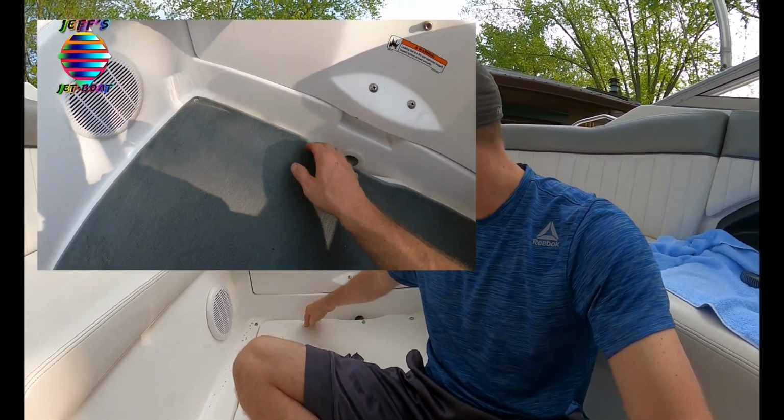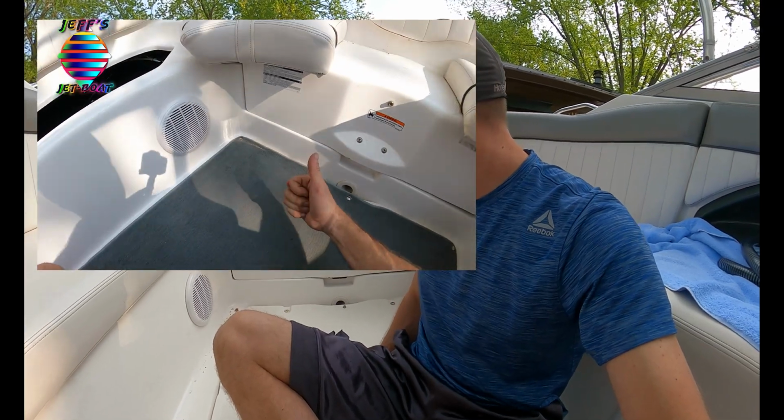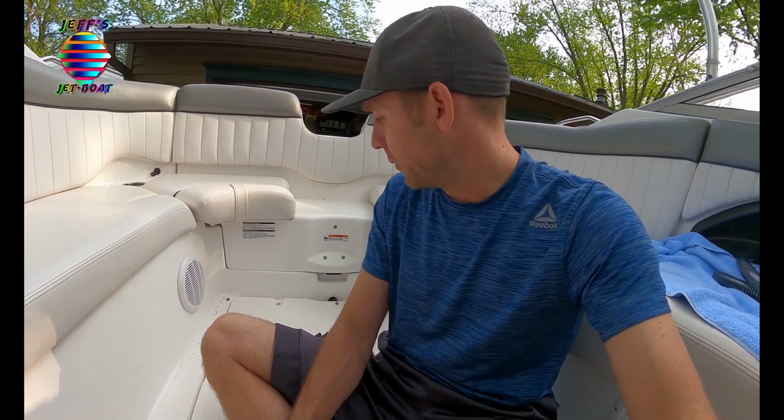And then some of you guys that have sea decking or whatever, dude, it'll just go right over. I mean, your carpet goes over it. It's barely noticeable, and it is what it is. So again, use your wrench first. Just work it back and forth. Use PB Blaster. Do everything you can for a typical stuck bolt. Once you get them out, then you know, you're gonna be fine.